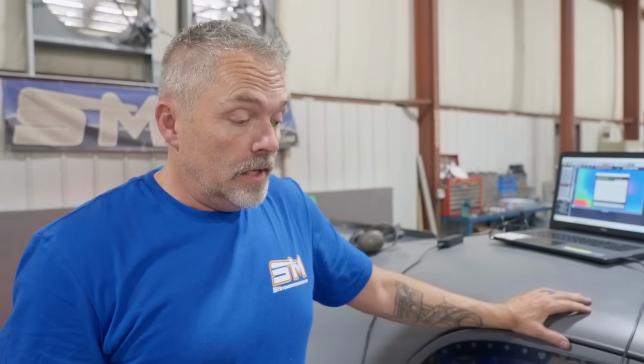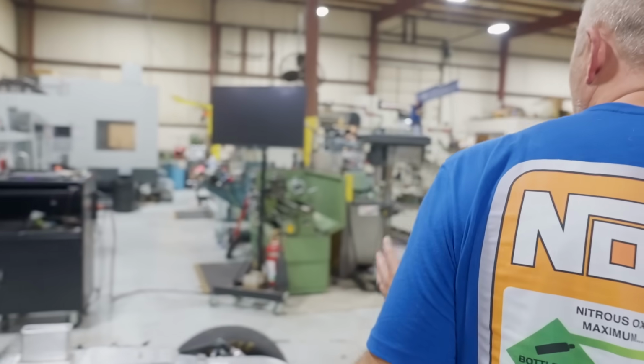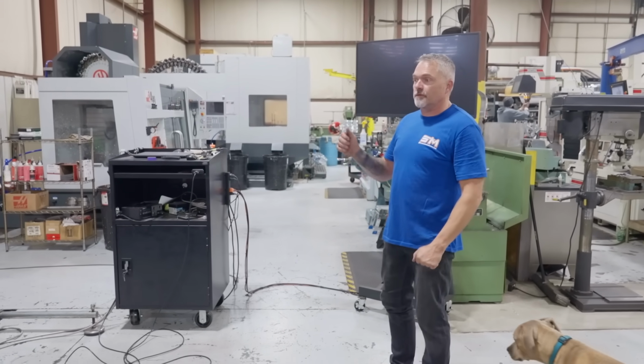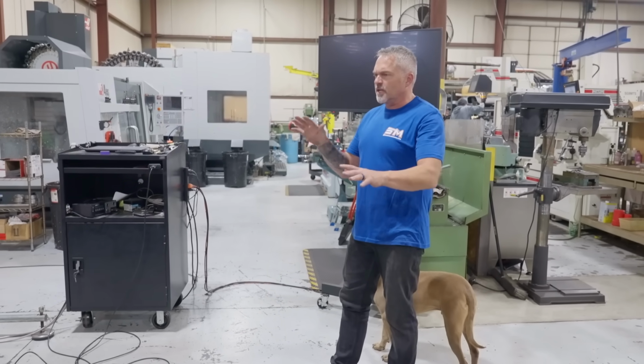Throttle's really responsive now. Okay. Throttle's responsive now. My job is almost done. So what we'll do here now is I'll get the dyno wall set up, and the only way I can really dyno it is you're just going to need to shift through part throttle, just shift through gears. And we'll make sure that looks good.